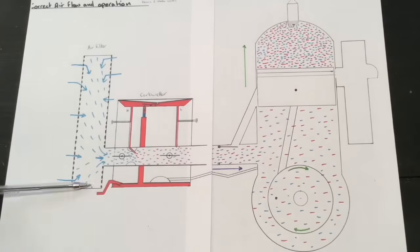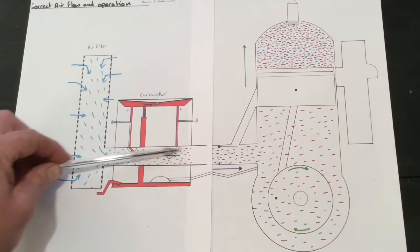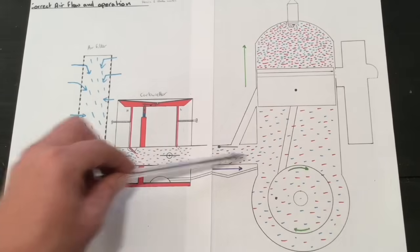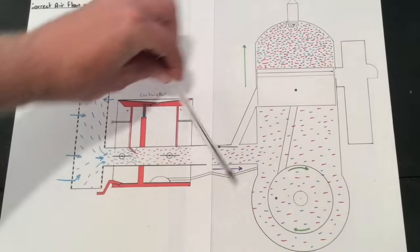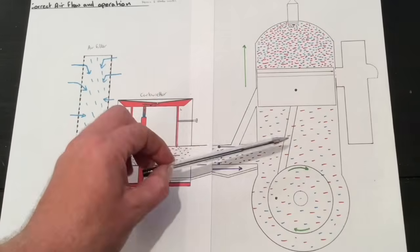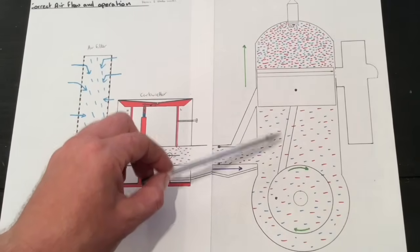So now we know how we've got the air, and we know how we've got the fuel — we've got the fuel-air mixture, we call that atomised fuel, and it's going into the engine. Remember, all this is all working at the same time. And as it goes into the engine, when the piston's in this position, the fuel and air mixture goes through another one-way valve here, which is open, and goes into the underside of the piston. So what we've actually got there is atomised fuel — fuel and air mixture — and of course in the fuel, we've got the oil.